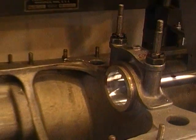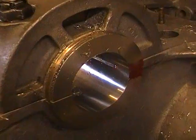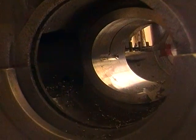This is a four bearing crankshaft. You can see we're working on number one right now, number two, number three, and number four is where the thrust is set on the crankshaft. So that bearing is actually very critical in terms of how its shoulders are cut. And once again here you can see the reservoirs and the oil grooves that have been pre-cut.